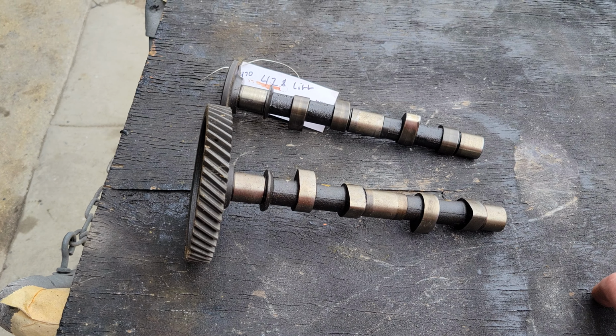When it's around 440 is kind of the area where you can look at the specs and determine this for yourself. This is just what I've determined: when it's around 440, that's when you're going to probably need dual springs. So if you don't need dual springs, it's better if you don't run them.